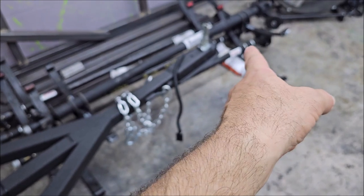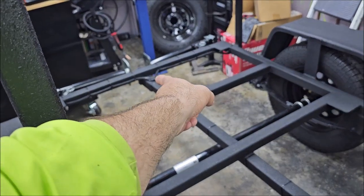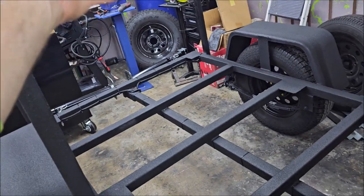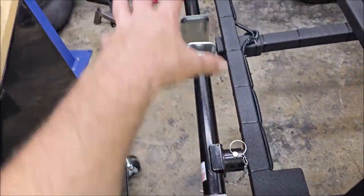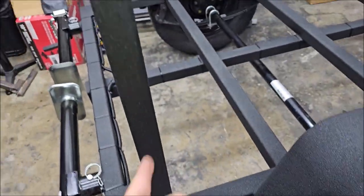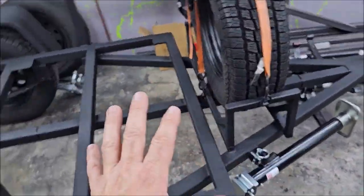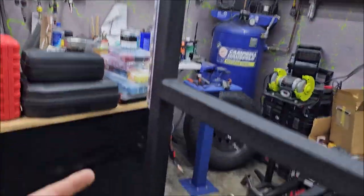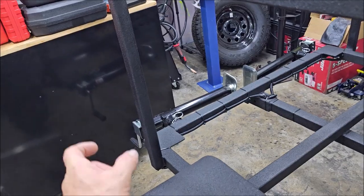There's a 2-inch receiver, and a full center bar that can be used as a tow point, plus a 2-inch receiver in the back for a cargo rack or bike rack. All of that is 11-gauge steel as well. This unit has the jacks in the back, LED taillights mounted high, and the wires run through the frame. It is all boxed in — no holes in the frame except where I had to mount the lights and where the wires go in at the bottom. I'm going to Dynaflex all of them so they're all sealed.